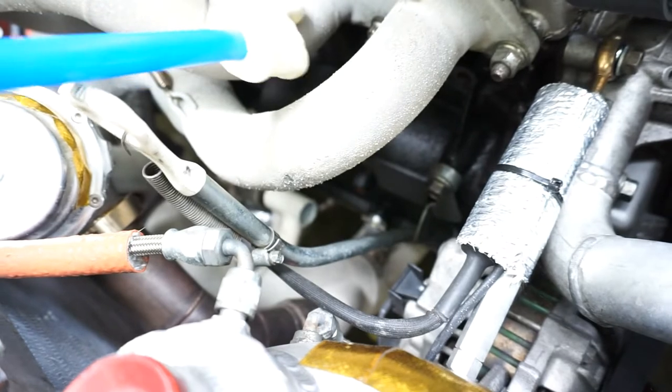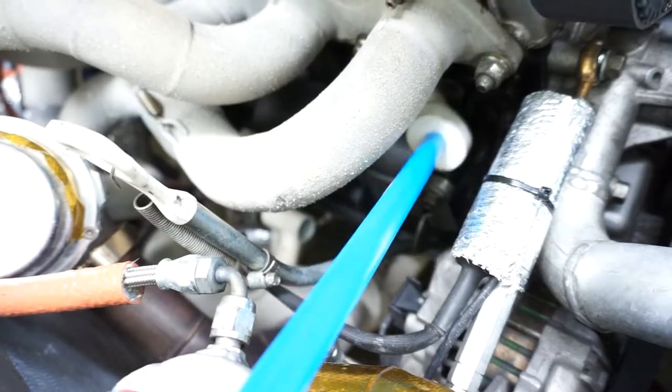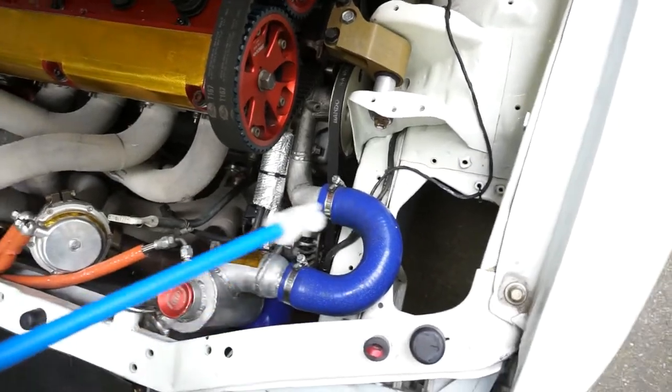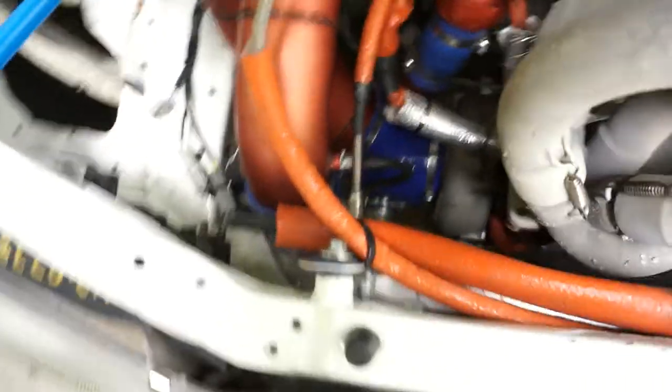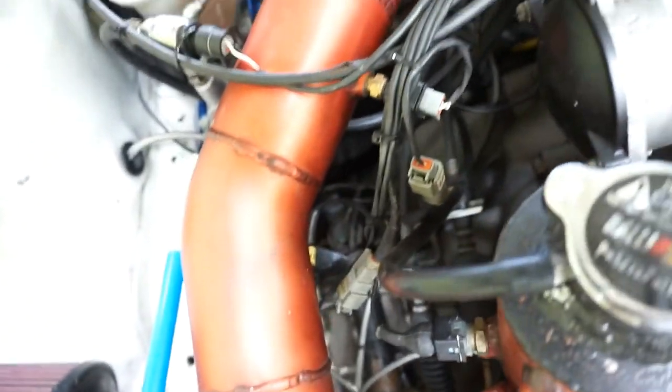I felt that cross water pipe is always a silly thing to have — just getting super-heated right under there. Instead this is a very simple loop into the radiator with a swirl pot here, just to accommodate how close these two things are together. The cooling system is good — it's a custom radiator from CNR. I was lucky to work with some engineers there that chose a nice core for me; the inner core is quite large, about three inches thick. I think it's a Garrett core.